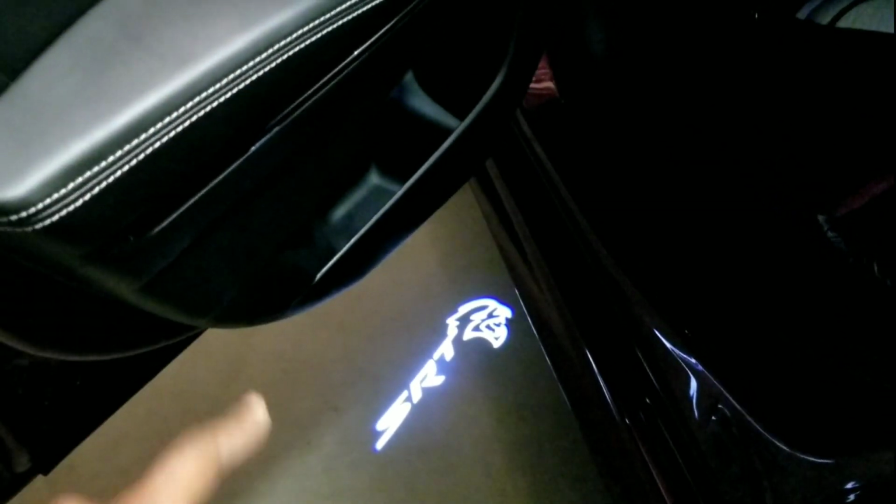Alrighty, Tube U. So I figured out a flaw with our lights, which they do work. All of them work. So these are labeled properly and the front are labeled improperly. I'm pretty sure I know my left from my right, and that one definitely says an L on it. So that one's facing the right way. This one definitely says left, but as you can see, the Hellcat logo, that's how it should be facing, but as it goes back into the car, that's how it comes out facing. I don't think your logo is supposed to be facing back towards you, you know what I'm saying? So we're just gonna swap the two, because obviously the stickers are wrong. Simple fix. At least they actually work, you know?